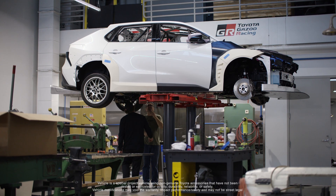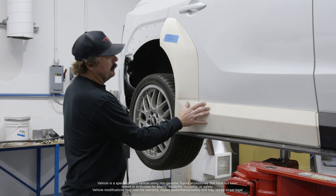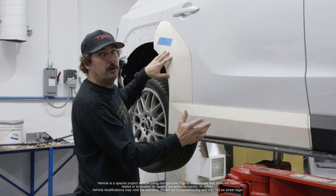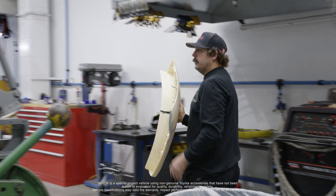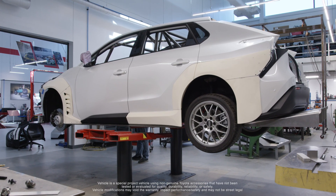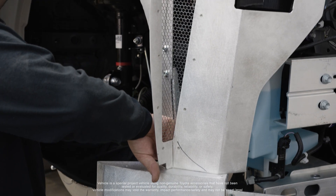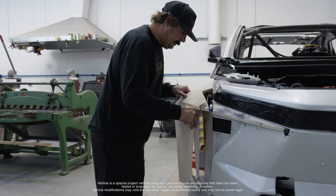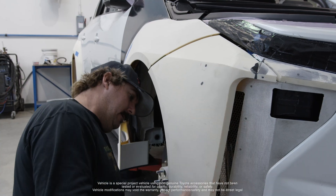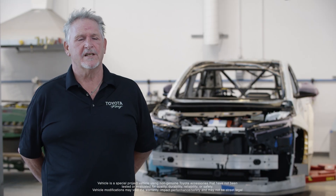The last couple of weeks we've gotten in all the 3D printed parts — front and rear fenders. We bonded two pieces together to make one piece, and everything gets bolted onto the car and can be bolted off. A couple studs and a couple bolts and you get a fender kit. We also screened in the front to let air in, disrupting dirty air in the wheel wells, with outlet vents from the back of the wheel wells. Overall, super happy with how the body kit came out and how it fit. It's at a point where I'm comfortable sending it to paint with only minor work needed.